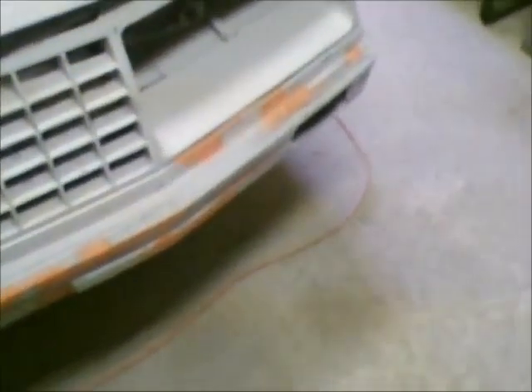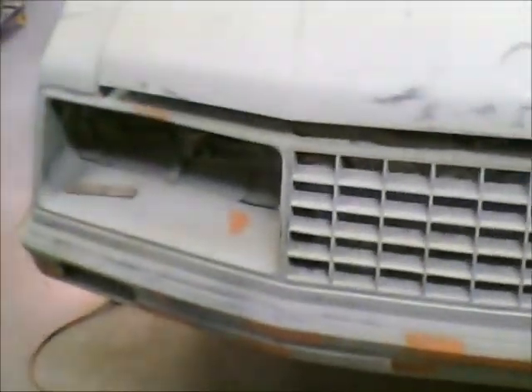I've not gotten a whole lot more done on the car. I've been going around it finding more spots and puttying. I did, however, kind of go back on what I told you guys earlier. I'd gotten to a pretty good point on the rest of the car and thought I might as well go ahead and get started on this. So I went around and got it all blocked out with 320. And as you can see now, it's got the red measles. That's the only bad thing about these front bumper covers — the type of plastic they're made out of.